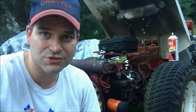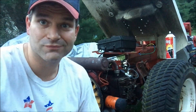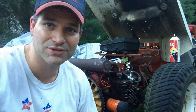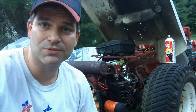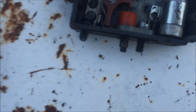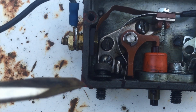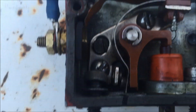I'm going to see if I can bring those condensers home tomorrow. Maybe we'll rig them up, and I'll take the points right out, clean them up nice, put it all back together and see if we can get some spark. It was running both cylinders and the spark was really strong too. I took the points box right off the 450, and if you look down here in this area, you can see the points aren't even close to lining up with each other.